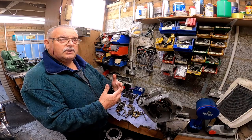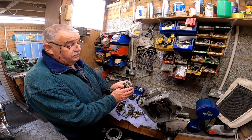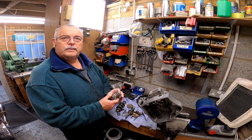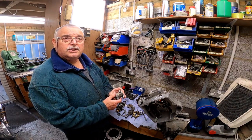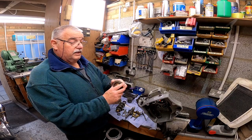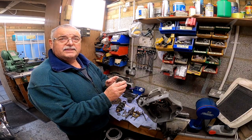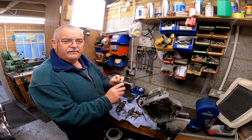So that means that the mesh on the teeth will alter, and the gears will become comfortable with these gears up here. And there's no arguing about it really. You can be pedantic about wear and geometry, you can draw parallel lines on a drawing board, and you can get AutoCAD to do it, and even high precision machining. But once you introduce bushes and clearance, inevitably these gears are going to end up not only moving within the scope allowed by the bush, they'll move a little bit because the bush needs clearance, and arguably they'll be able to rock as well. So they'll sort themselves out, and there's no point in being pedantic then about the contact patch or evidence of wear.